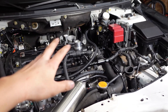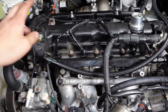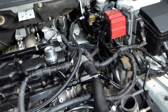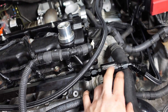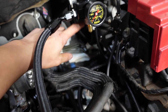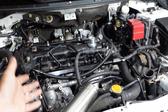The fuel system for the car is finally done. I have the Walbro 450 for the fuel pump in the rear, everything is hooked up. Up front, I have the AMS fuel rail with AMS fuel pressure regulator. As for the injectors, these are FIC 1650cc injectors, and then a MAD Performance inline fuel filter. From the main feed line coming up, it goes into the MAD Performance inline fuel filter, into the rail, onto the injectors, and then out as the return line into the regulator, and from the regulator out the bottom to the return line. Everything is hooked up and tied down — the fuel system is done.